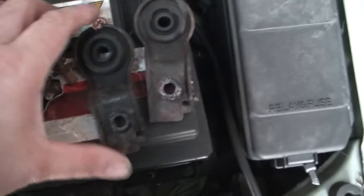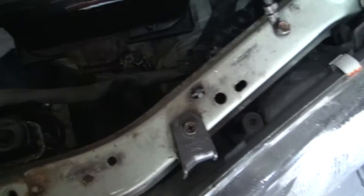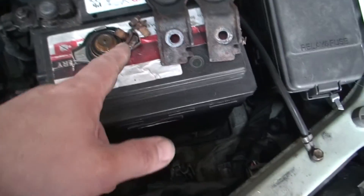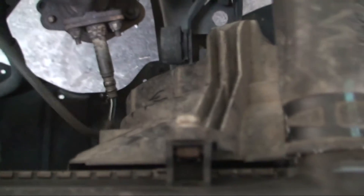As you can see, these are little clamps that just go over a little bit of rubber — very easy to remove. They're 12mm bolts. Now this wire here is for the lambda sensor. You don't have to disconnect it; you just need to pull it away from the housing there, so just pull it out of the way. This wire on this side is for the fan.